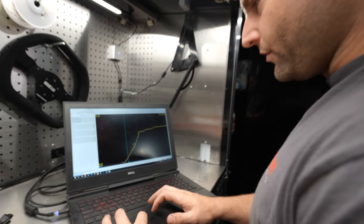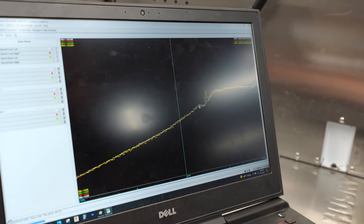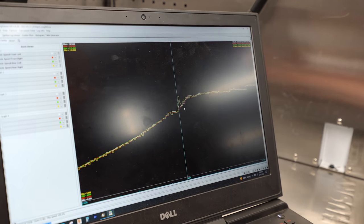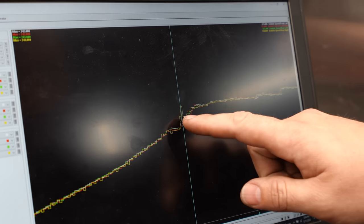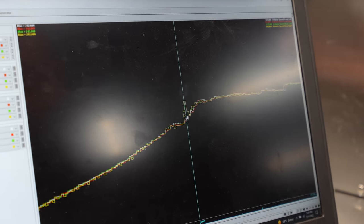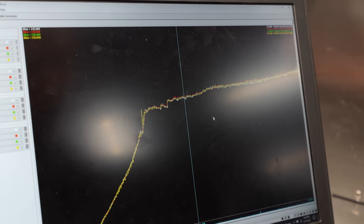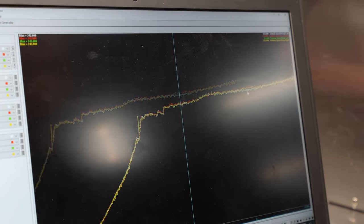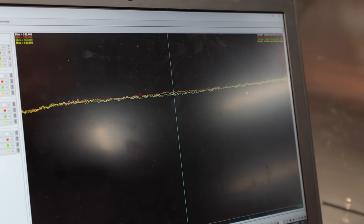These are all four of the wheel speed sensors logging as quick as the ECU will let it. You can see some really interesting things right there. You can already see a differentiation. Green and yellow are the rear tires, so maybe a little bit of slip or drivetrain slop right there. And then everything else seems to be all fine. Whatever the red tire is seems to be a little bit different. And you can see, just even the slightest bit of turning automatically affects the car.